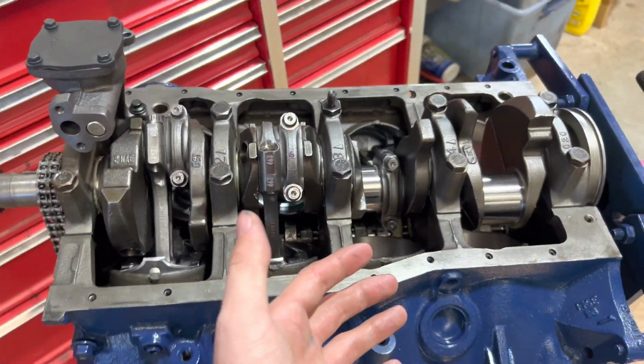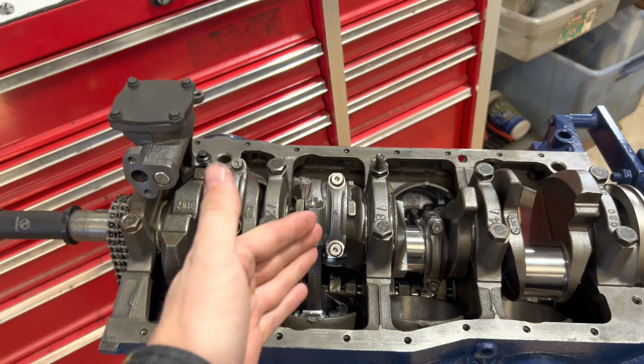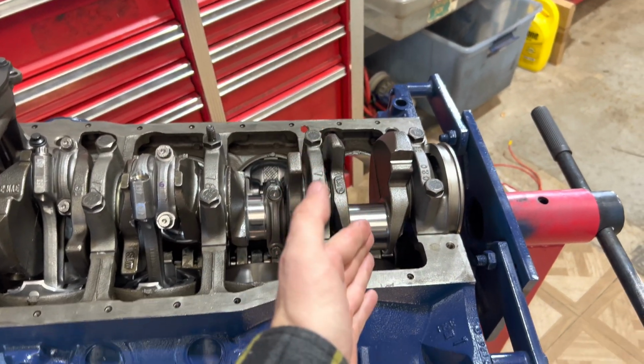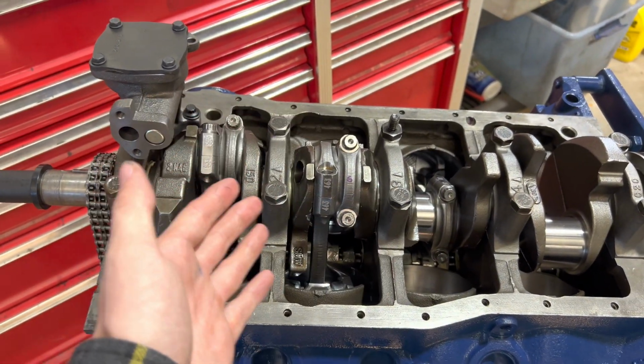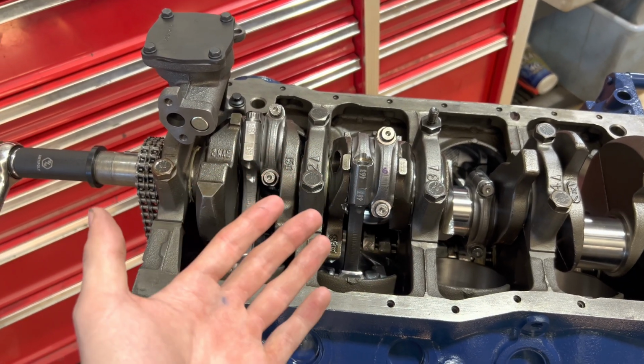As I was building this, I put the connecting rods to the pistons and installed them in the motor. I actually installed the first 6 because my dad broke the piston rings on the last one, so I didn't really install those. But anyway, I installed these, posted the video, and a guy commented, I can't remember his username, but he pointed something out that is very helpful. I fully admit I completely missed it, and that is there is a certain way that the connecting rods are supposed to go. At first, I did not see it, because they look the same on the outside.